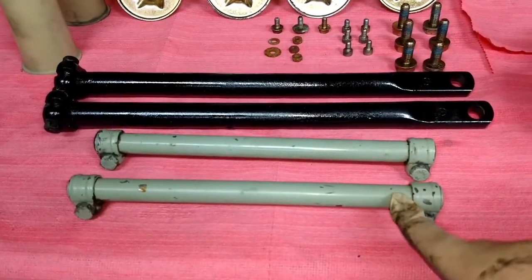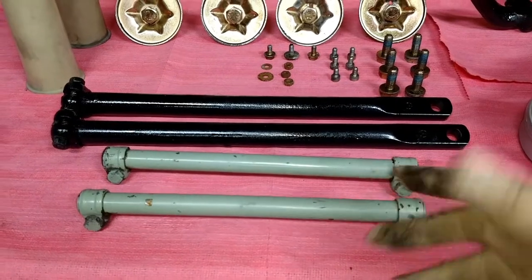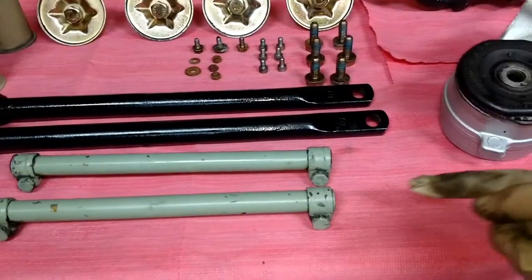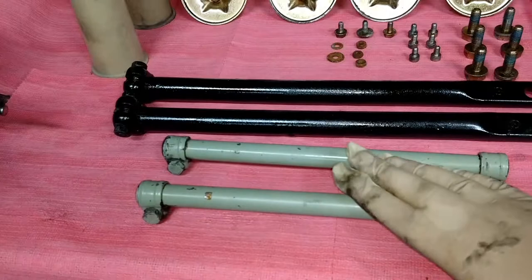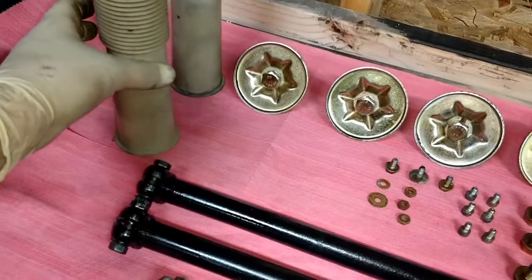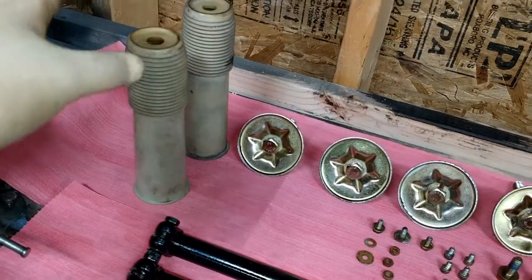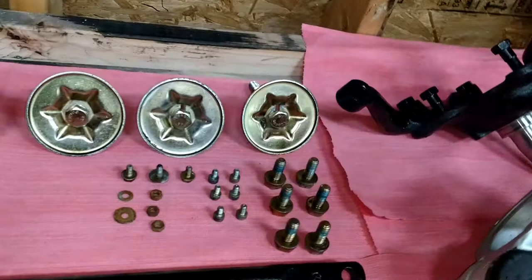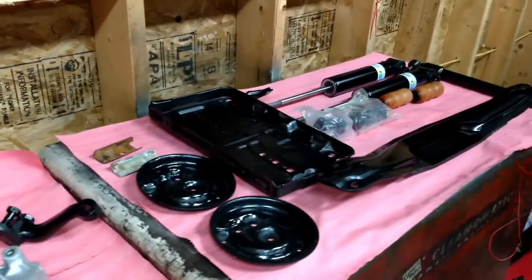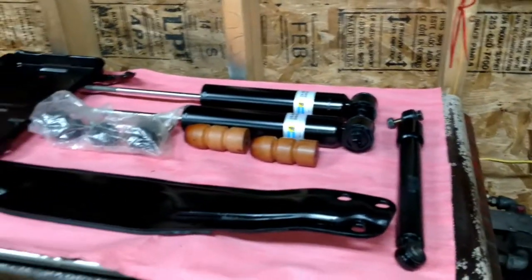Here are the original tie rod arms — these are really high quality, made by Mercedes. The aftermarket ones — if you get Mercedes brand, they're pretty good, but these are the original. So it's best to just get tie rod ends and replace the ball joints for the tie rods, but keep these originals. Here are the shock covers from the original shocks — cleaned up really nice, just plastic covers, not cracked or damaged at all, so I'm going to use those. I've got a box load of new parts coming — bushings, shocks, center link, all the front suspension stuff — should be here tomorrow, and then I'm going to start reassembling all of this.